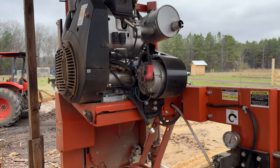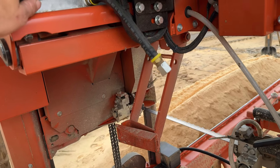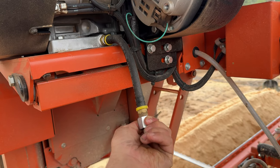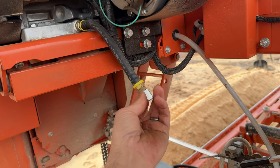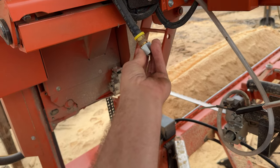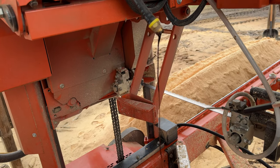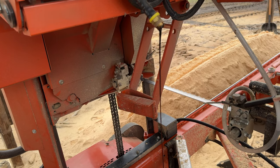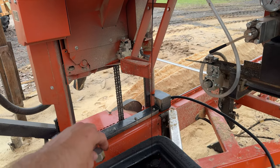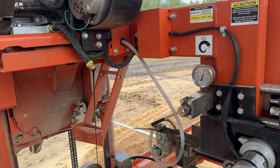Let's get this oil changed. We're going to start by warming up the engine — I've already done that off camera. We're going to now loosen this; I pre-loosened this a moment ago. I've got my oil pan below and I'm going to try to get no oil on myself. Sort of successful — a little bit on the tip there. Now we're going to wait a few minutes and let that drain.